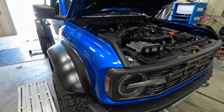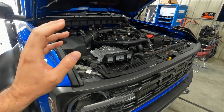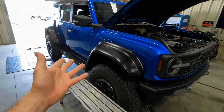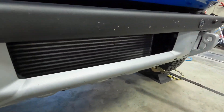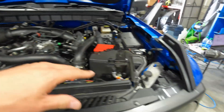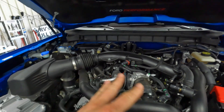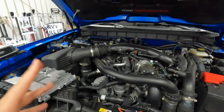So we're going to try a few things — put their tune in this. They've already tuned one and we know it is dialed in. It's going to make a lot of power, but the one they've shown before was stock, and of course our Bronco Raptor is far from stock. We've got a Whipple intercooler up front, SPD downpipes, and the factory intake on it now. But after we get the tuning in and run it as-is, we're going to see what the S&B intake will do with the HP Tuners Five Star custom tune.